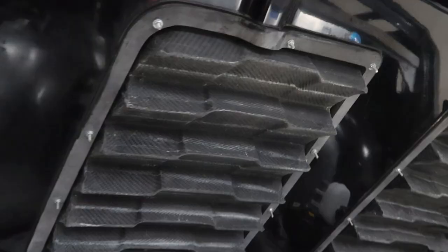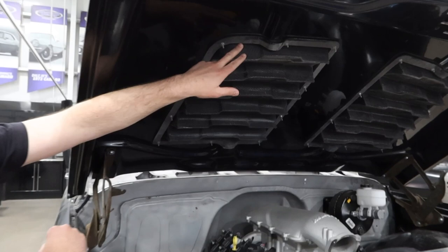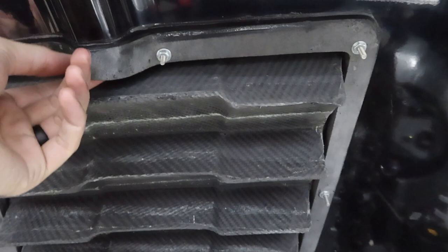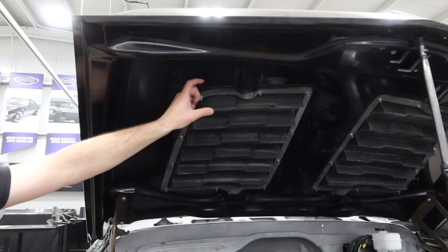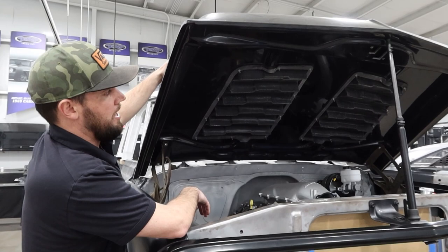You'll still get some function out of it without having it totally wide open to the bottom. You see a lot of people put different vents into hoods — but detail like this, it's actually a reinforced ring all the way around it so that when you tighten this louver set in here, you're not actually distorting the hood around the perimeter. That's what makes a really nice part. The cheaper carbon and fiberglass hoods will either have a stock style under structure that's windowed out, or sometimes no interior panel at all. But these hoods — it's the full outer shell and then a full one-piece inner shell. Really, really strong, and finished out much, much nicer.